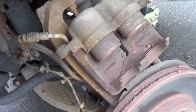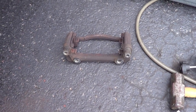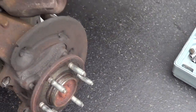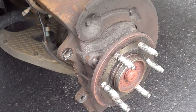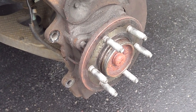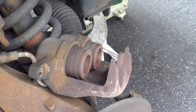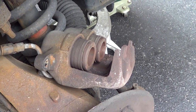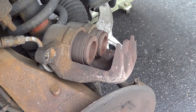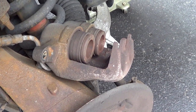Now we'll get that bracket out of the way and you're going to be able to see the mounting holes for the bracket itself as well as the sliders that the caliper bolts onto. Then we'll take a look at the pistons that are part of the caliper — we're going to compress those in just a minute using another tool. When you go to do this compression process, just make sure you don't pinch that rubber that surrounds each of the pistons.